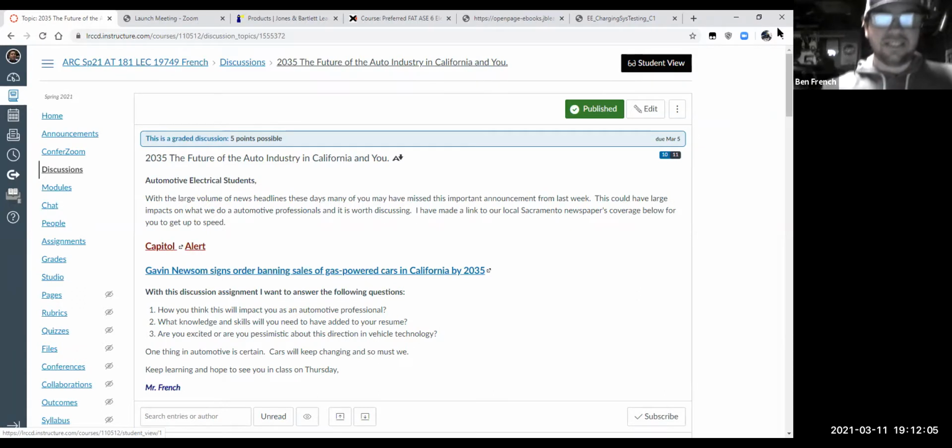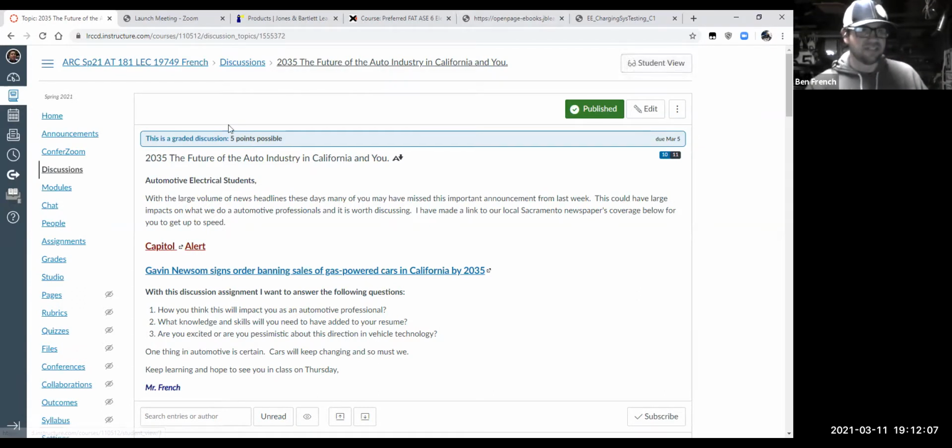With that, I think that kind of catches us up. We know what we got to do, right? Our assignment is to do those charging starting system tests where we're doing state of charge, available voltage, and then our voltage regulation. And really, it's only seconds to do, but it tells you a lot of information when you understand what you're looking for there.